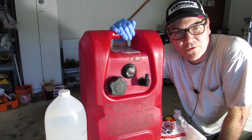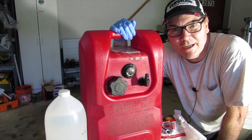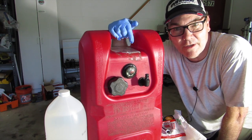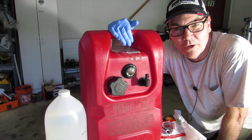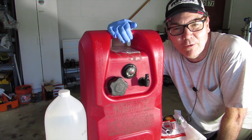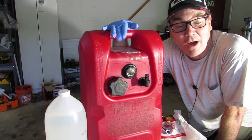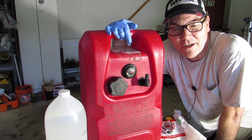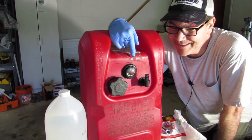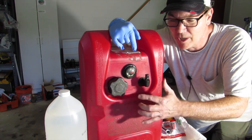What I try to do when I make one of these videos is do something decently, trying to do it kind of the right way. I'm sure people will comment that the right thing to do is just buy a new tank. These tanks are $80 new, which isn't cheap, but it also isn't expensive. And it's fuel — you could risk a fire, you could risk blowing up. I know all that. I'm just trying this out. If I destroy this tank trying to fix it, that's okay. Unless I melt the plastic here, I'm really not taking too big of a risk because these tanks are meant to be pressurized. This area is meant to be sealed tight — anything that is supposed to release pressure is either the cap or through the fuel line, not here around the gauge.